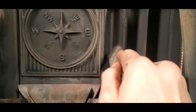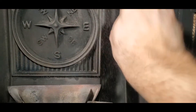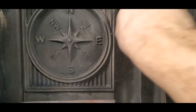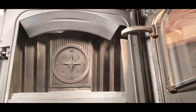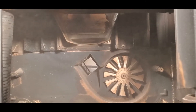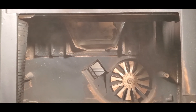I like to use a dry paintbrush — I feel like I can get more surface area in here with a dry paintbrush, using different sizes. A lot of times I'll use a big fat two-inch wide paintbrush. We'll see it gets into the top right here too. We're cleaning that ash out — the more ash that's out of here, the more heat that's going to be pumped out into the house. It's that simple. Just get those heat exchangers thoroughly cleaned all the way up and all the way down. Good practice to be doing that about every ton of pellets or so. That is the overall cleaning of the heat exchangers inside a Harman Accentra — very similar on a lot of the other Harman models. The main thing was the removal of that combustion baffle plate and just a little trick to help you get it out easier without banging your knuckles or getting frustrated.